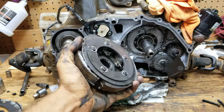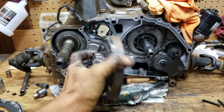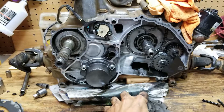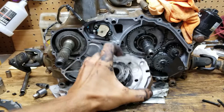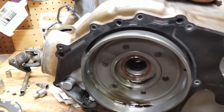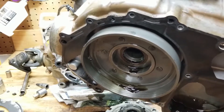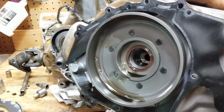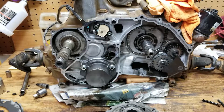Here's the wet clutch I was talking about — you can see these shoes are worn out. It's done. You can buy a whole new assembly or get the shoes and rebuild it. I found links on eBay — I'll link them in the description so y'all can get the shoes and just rebuild this thing. This part of it is kind of grooved out, so I'm not too happy about that. I'll have to do a little more research, but I've got it all apart now. If I have to buy a whole new used assembly, I guess I'll just have to do that.